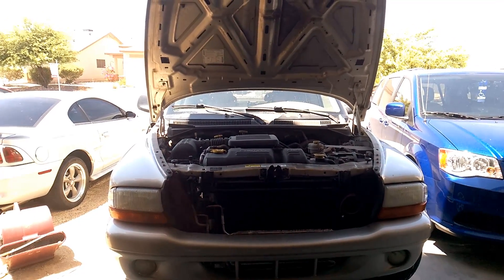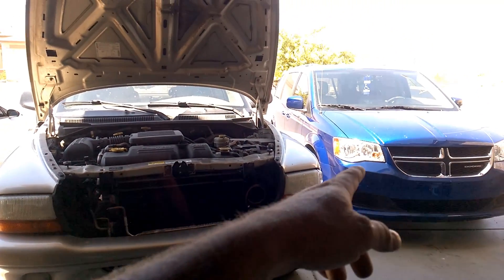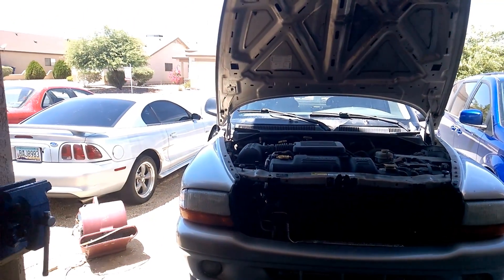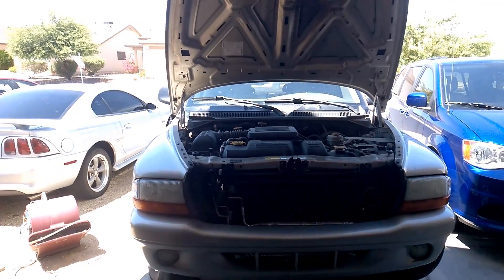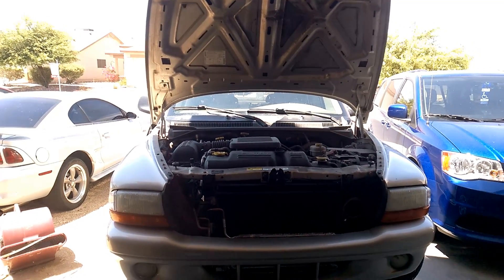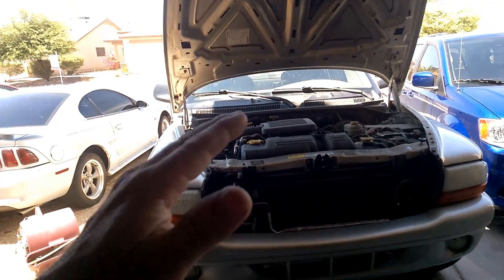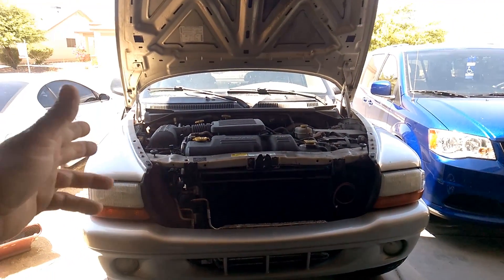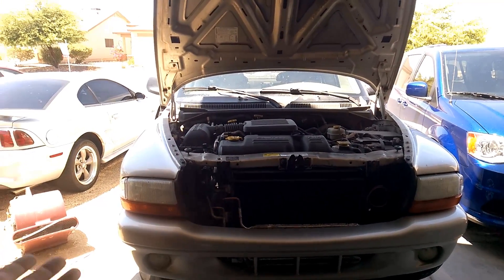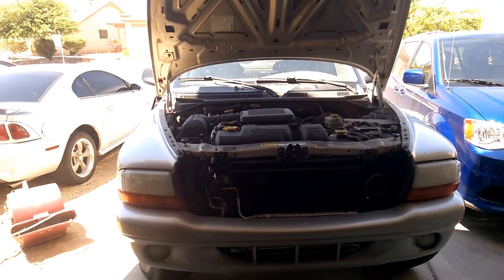He said the air wasn't great and it really sucked when you were stopped. It works better in our newer Dodge over there, and it's ice cold, and in that old '96 GT over there too. So I guess you really notice it when you have better air on the other vehicles. One thing I noticed is when you charge it, the suction — I mean the superheat — is high. The suction is warm. It's as if it doesn't have enough refrigerant, but the pressure is way up there. So it's not a restriction or anything — it's just like it doesn't have enough refrigerant in the evaporator.